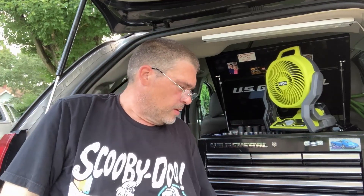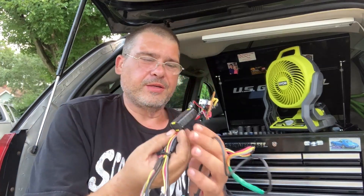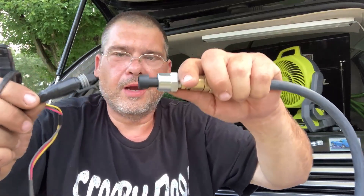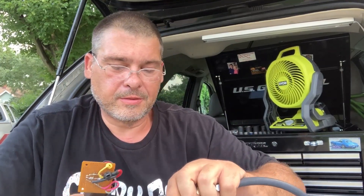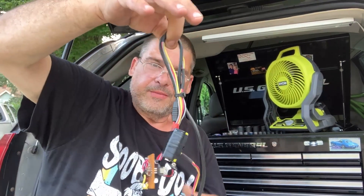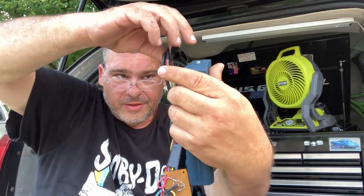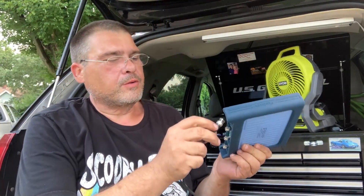This part hooks to the pressure transducer to power it. I'll put a link to the video where I built this — it has a nine-volt battery, an LM7805 voltage regulator with a couple of capacitors, and it comes down here where I hook it into the pressure transducer. I put a coax BNC end on the output and I leave this looped with a brake caliper hook that I hang from the hood pin. I hang the scope on the hood from a little hook as well, so everything hangs up on the hood, and then I just plug directly into one of my scope channels with the BNC — and you're good to go.